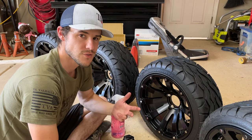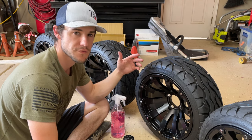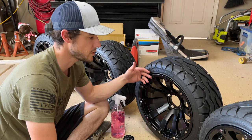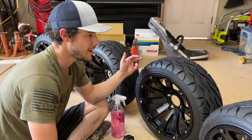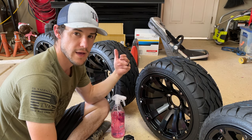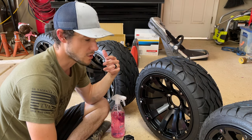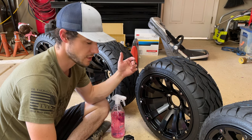All right, so obviously I can't put all the work into this cart without upgrading the wheels and tires also. So for that combination, I decided to go with the Modzy Bomber 14-inch wheels on the Street Fox 205/40/14 tires. I believe this is the largest that I can fit on this cart without adding a lift kit. I didn't want to go all terrain because this cart will be on a golf course also, so I need turf or street tires so that it meets regulations and everything.